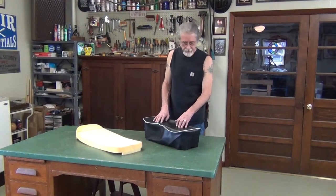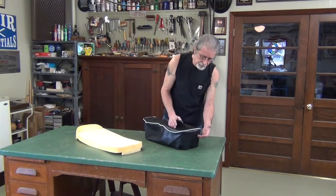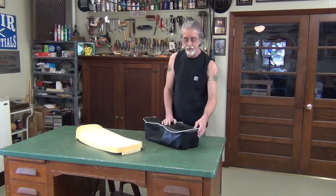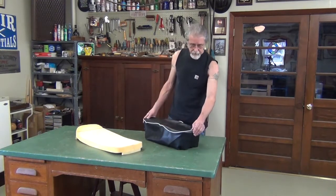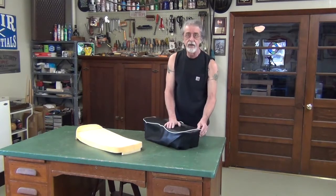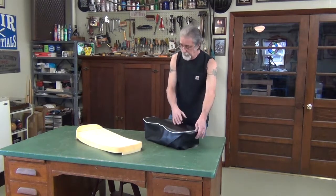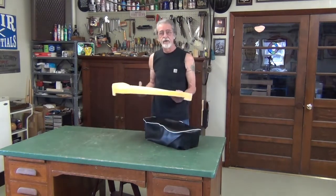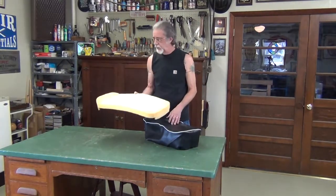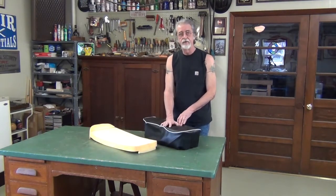In researching this seat, I found that some were marketed with two seams and the Sears logo, and other covers without the logo had a single seam down through the center. The customer ordered a replacement cover from Austria and it has the single seam, so I'm going to make alterations and include the Sears logo. A few years ago when I restored one of these, I found that this HR70 inch and a half thick worked great. I'm going to follow a similar design, only tailored to fit this cover.